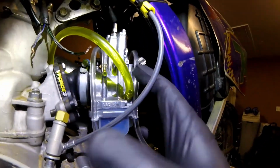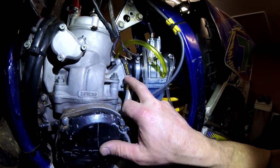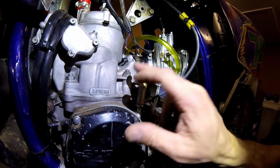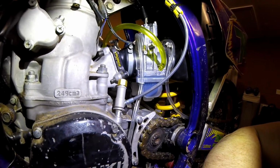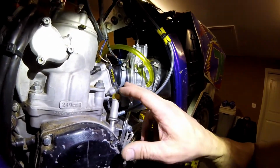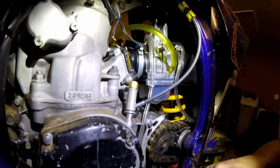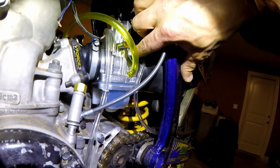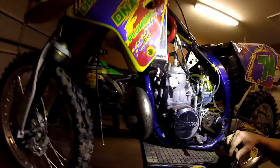There it is, boys. It is locked and loaded. All right, boys, we got the Lectron on there. We had to take off the little spacer that I had right here between the cylinder and the reeds. Had no choice. We didn't have any room back behind the shock. This thing was difficult to mount up, but I found it easier to put it into the front, work the back on, then tighten the back once you get it on, and then finish shoving it forward. Be sure to get it on all the way around, both front and back. It is kind of tough, but nothing to it. Just got to do it.